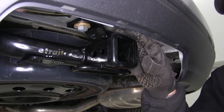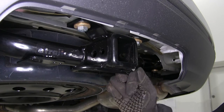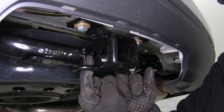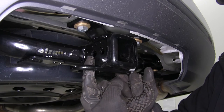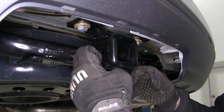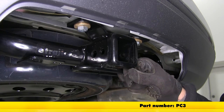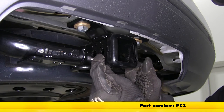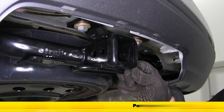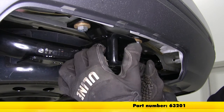This is a class 3 hitch so you're going to have a lot of options as far as accessories. In the rear, there's a larger pin hole that you'll slide your 5/8-inch pins through — that's a standard pin size available just about anywhere, including eTrailer.com, part number PC3. The smaller hole in the front is for use with the Draw-Tite J-pin style anti-rattle or security device.